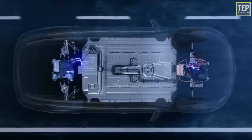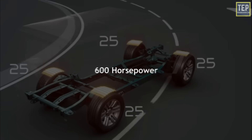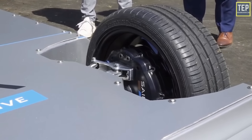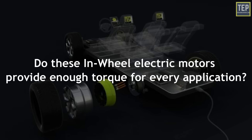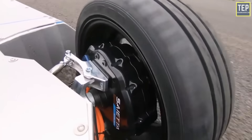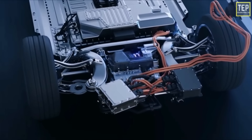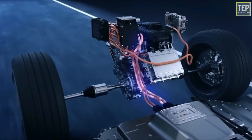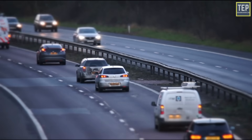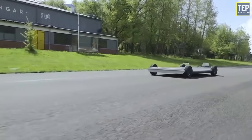Pure electric vehicles with in-wheel motors have a simpler design for both chassis and drivetrain, and do not require any drive shaft, differential, or transmission. The combination of several in-wheel motors can put out more than 600 horsepower, and they can recover their own energy while braking. In a vehicle equipped with in-wheel electric motors, there's plenty of torque available almost instantly. Electric motors produce a high amount of torque, and since that force is transmitted directly to the wheel, very little is lost. Each wheel can be equipped with sensors to determine how much torque is required at any given time.